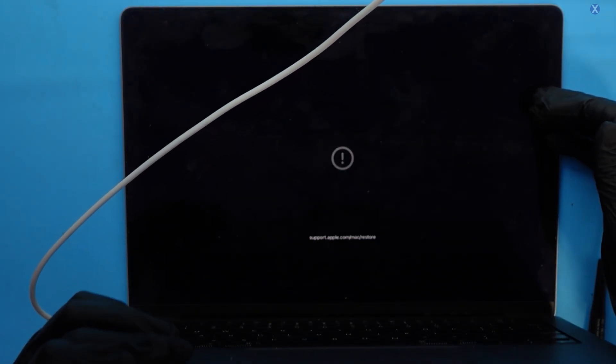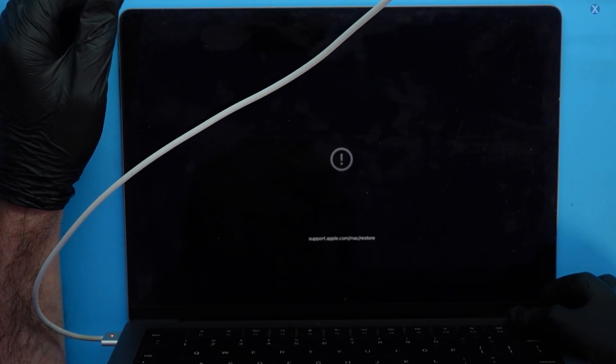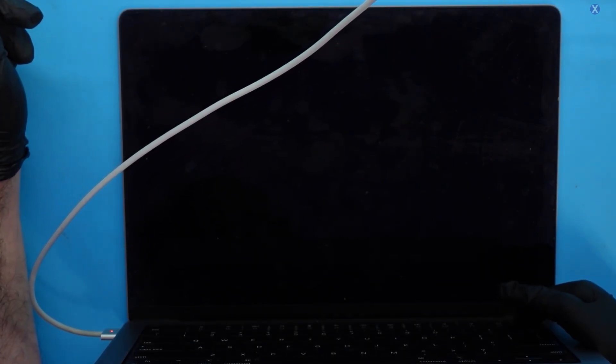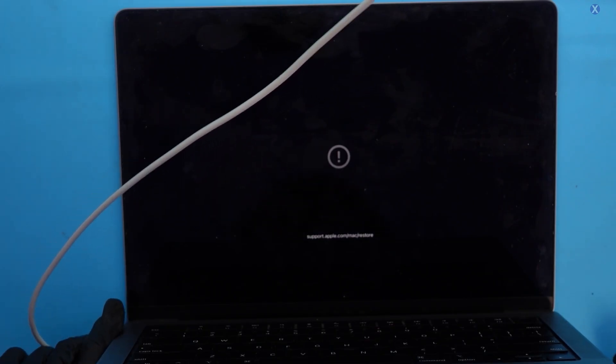We got the MagSafe light and we're hit right with a restore. So this looks like a firmware issue. We hope that there isn't an actual problem with the SSD. When you have liquid damage like this on Apple Silicon devices — or any from around 2018 and newer — they have a security chip on there, so it's firmware. If the NAND got impacted, or it thinks there's no operating system, you can get something like this. We would need to do a firmware restore. We have an in-depth video on how to do this. Two different methods. The customer isn't concerned about the data, so if we need to wipe it, we're fine to wipe it — we just need to make sure it powers on and works.